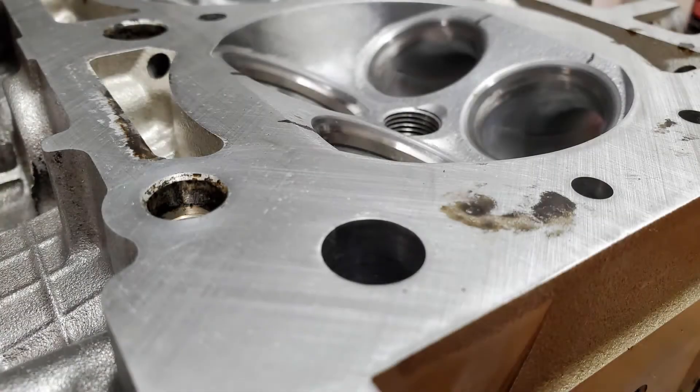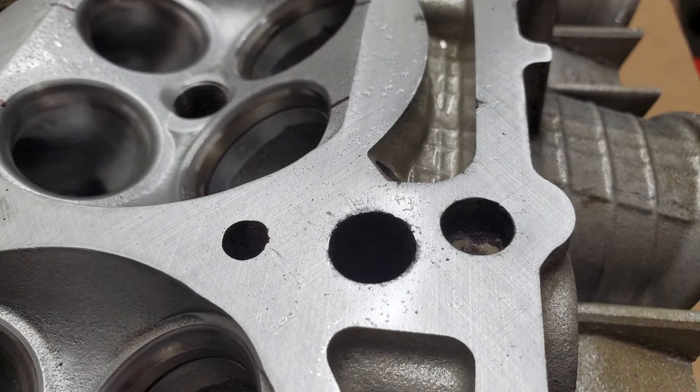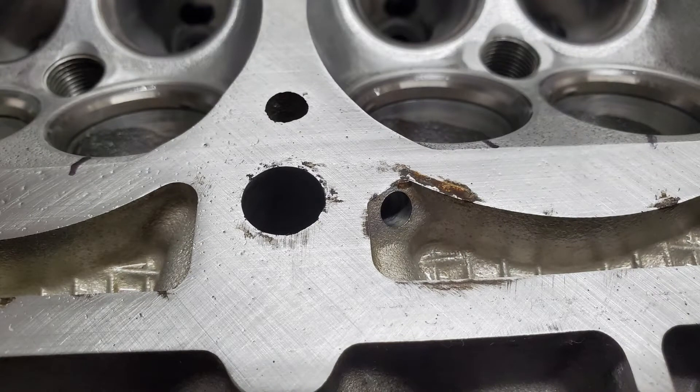Here's a good look at the crosshatching on the surface of the head. Even though it looks a little bit rough, you really do need a somewhat rough surface to be able to grab the gasket and seal properly — otherwise, if it's too smooth, a composite head gasket would leak. You do want the surface to be more smooth if you're going to use an MLS head gasket; you would probably go up to 800 grit after this. But for this case, using the stock head gasket, this is going to be fine.